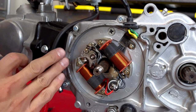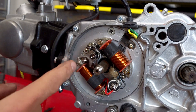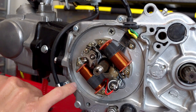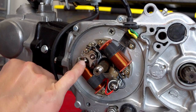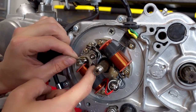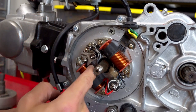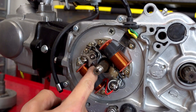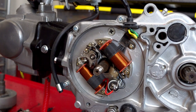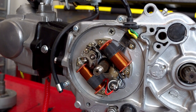Something else you can check is the points. On new points it probably won't be a problem, but particularly on older points this is one of the main things I do first. Just open it up and using sandpaper on both sides, run it through a few times to make sure any buildup on those contacts is cleaned up. With new points I didn't think that would be the problem, but it was something I tried — and in this case it wasn't the issue.